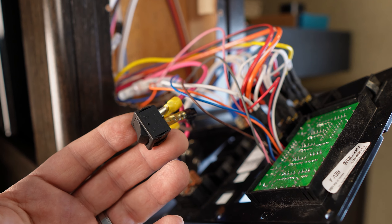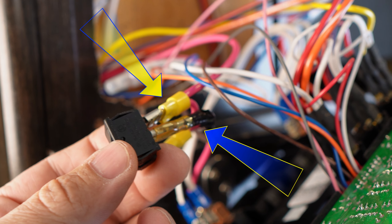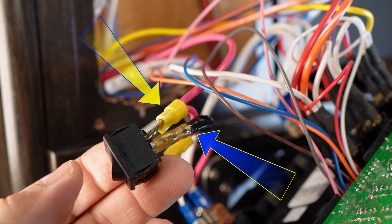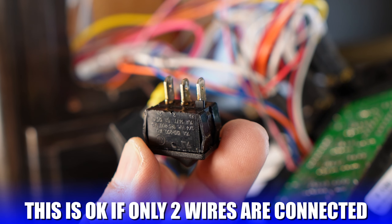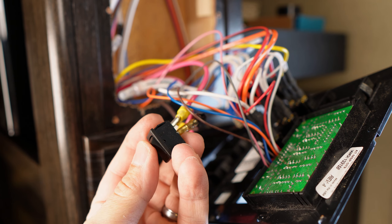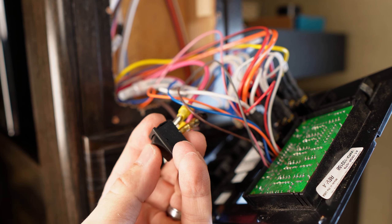If your light switch looks like mine, it's got two terminals. One of these wires is constant 12-volt positive from either the battery or the converter, and the other goes back to the 12-volt positive side on the light. Some of you may find a three-terminal switch instead, and even though this switch is a little different, you'll most likely still only see two wires coming off two of the three terminals. When the switch is turned on, the circuit is closed, allowing power to go through the switch and out to the light. When the switch is turned off, the circuit is broken and no power is allowed through to the light.